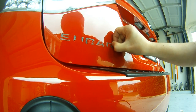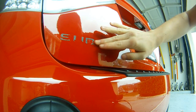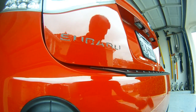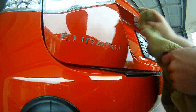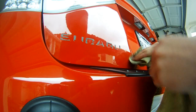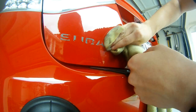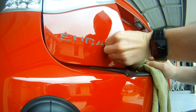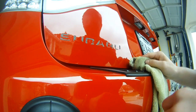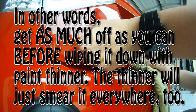Now that it's kind of hot again, I'm going to get my thumb in here and just start loosening some stuff up. Anything you can't get off with a towel, that's what you're going to use the lacquer thinner for. Then after the lacquer thinner, I always do a quick round of wax. Get any of the thicker substance - the thicker part you didn't get off - take that off first. And if it's just a smaller part there's no way you can get off with a microfiber towel, that's the stuff you're going to have to get off with the lacquer thinner.